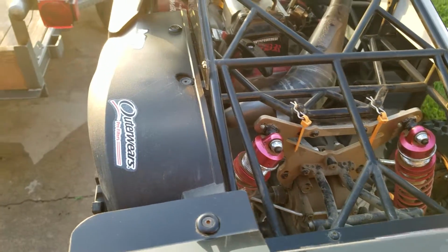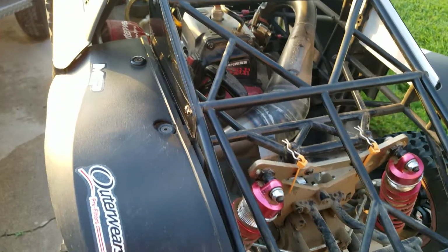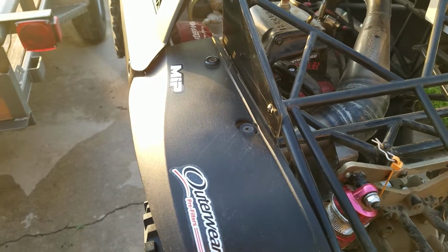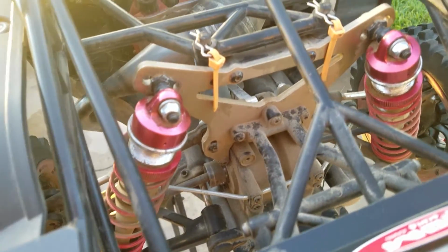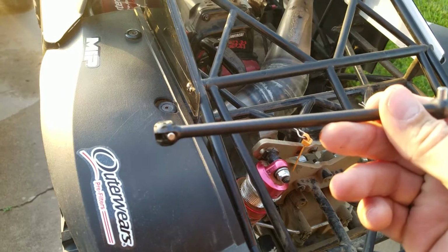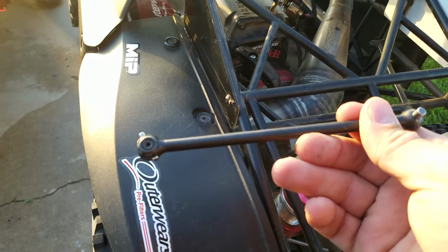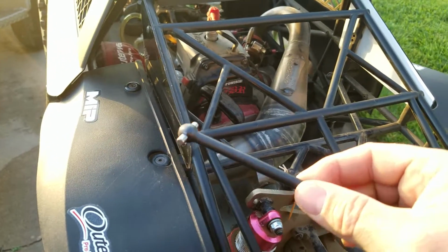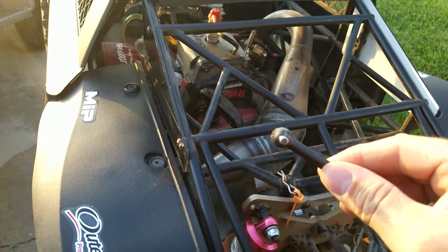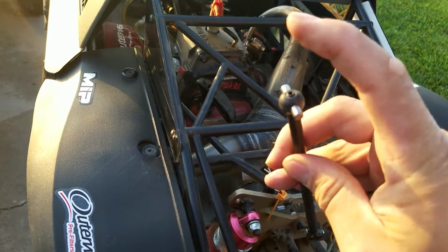So, that being said, let me talk a little bit about what got it to this point. You probably remember the last video I talked about, I sheared off some drive pins from the front diff, and then ended up shearing off a drive pin for the rear diff. Well, got all those in. Ordered in these here. These are from Fastlane Machine. They're hardened steel, with a lifetime warranty on them against bendage, breakage, all of that good stuff. Plus, they have replaceable pins that you can purchase. They're serviced by a set screw that you need to make sure that you Loctite well.